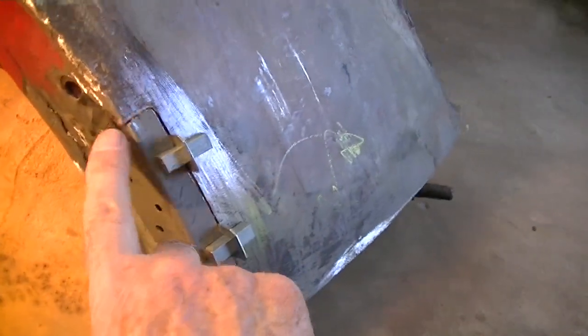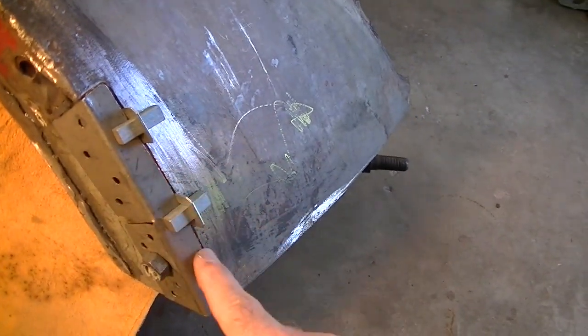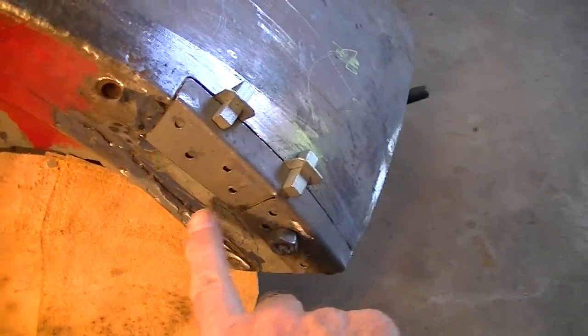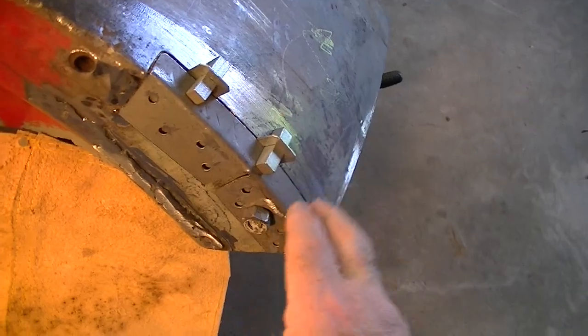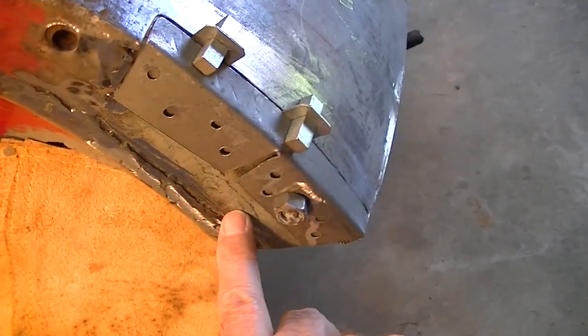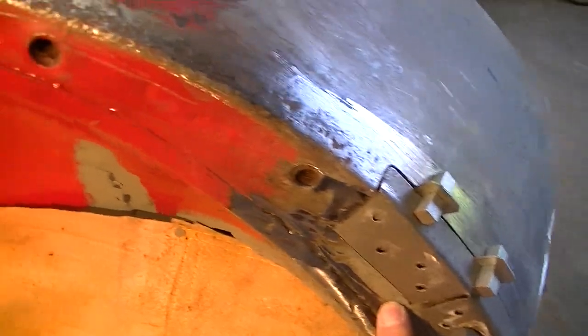of this, and I'm going to weld this piece more along here, down here with a butt weld down at the bottom, and then later on, after that's done, I've got some holes pre-drilled here for welding this flange from this front piece onto the actually the part that was underneath that I put in first. That part that's underneath, this is actually a kind of three pieces along the shroud here.